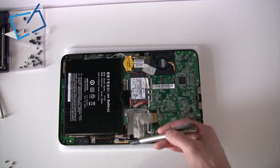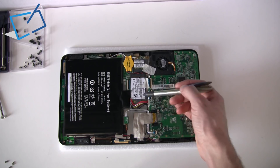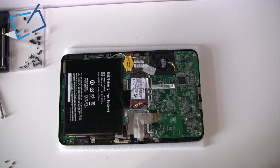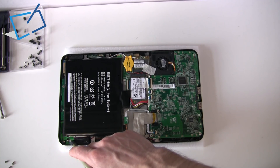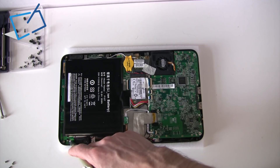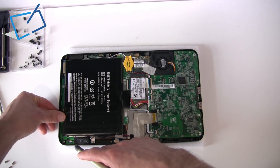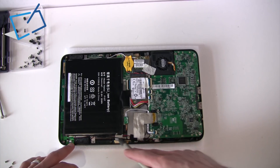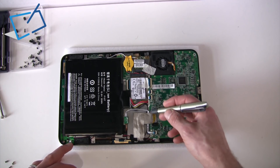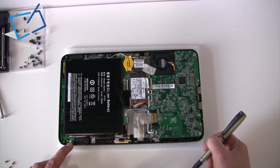This area here is where the SSD would be, and this is the mini PCIe slot for the 3G card which we've already installed. Here is the 3G antenna that is custom made for this device — it's not in there by default. This whole green area from below my thumb to just by the side of the speaker is the 3G antenna, and the wire routes along here behind the SATA connector and into the 3G card terminal.